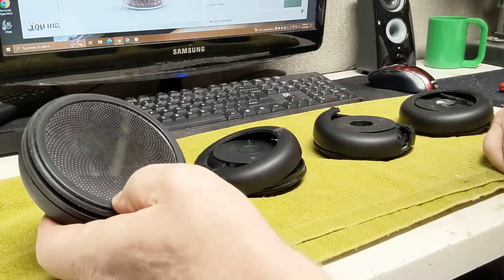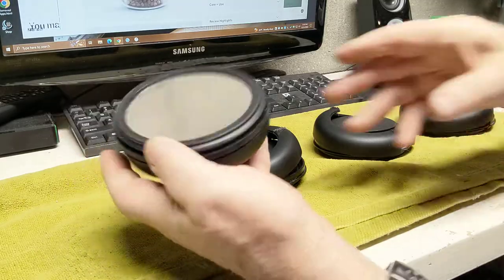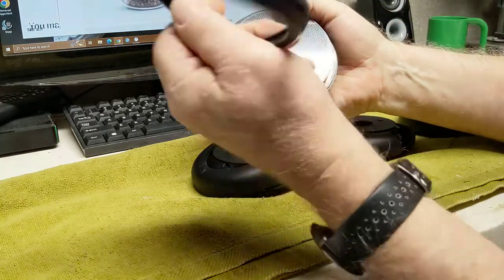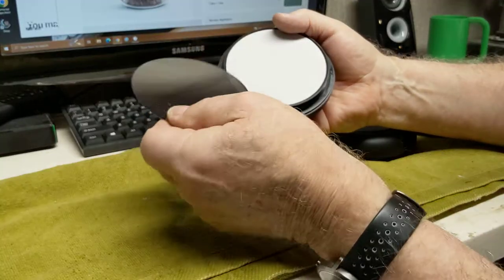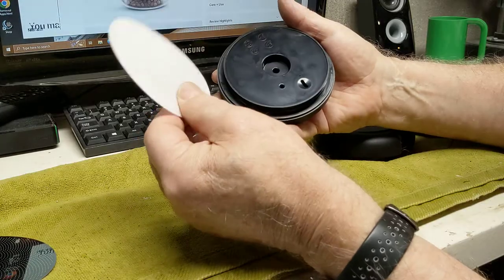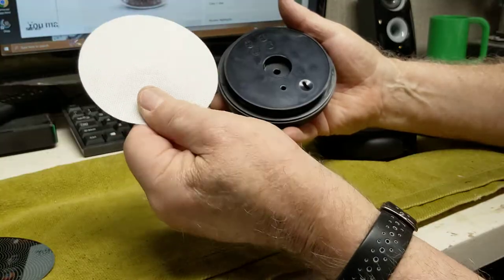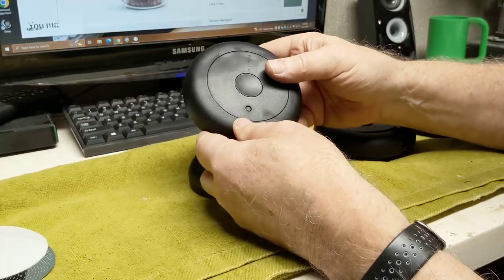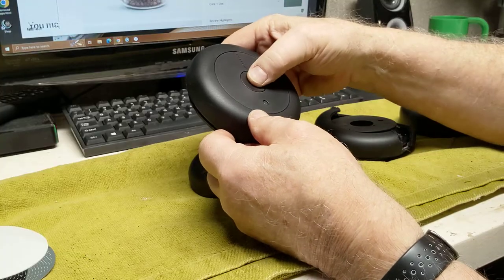This first piece is a lid for the Atmos that is intact. This part you can take off, and you should take it off and replace it on occasion. There's a rubber gasket on the top, then a little metal mesh that protects the filter, and then a paper or maybe polyester filter that you need to change on occasion. That's basically as far apart as you can get it — those are the only interchangeable, repairable parts you can actually replace yourself.